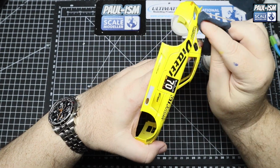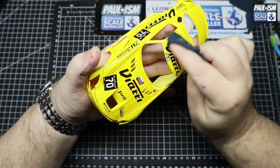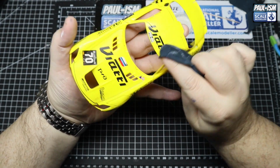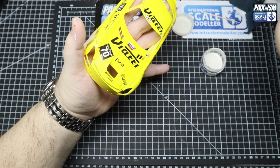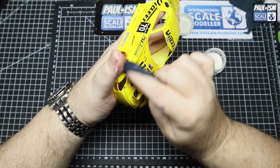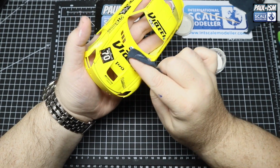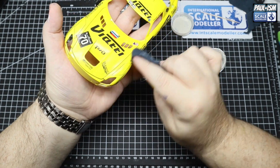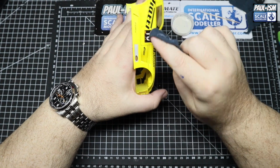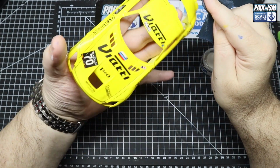Now, 2K went really well. One thing I did notice is there's heat shields on the exhaust. If you look at the other side, not this side here, the other side, the decal's lifted ever so slightly at the top. You'll see it in a bit. UMP polish here, same as the compound, just go around polishing it all up. This will give us a higher shine and get rid of any micro scratches in the finish. Back to the decal though, the decal's probably lifted because it was on an edge and it probably wasn't quite set in place. So, user error.